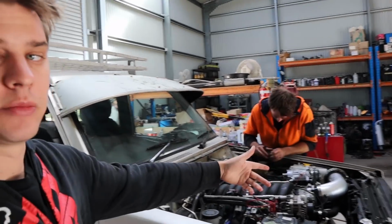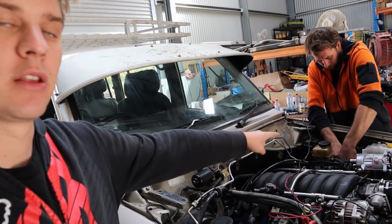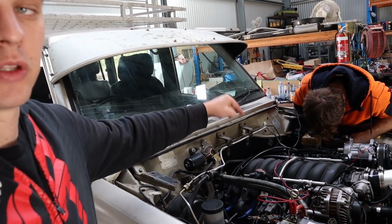All right, so the experiment did not prove what we expected it to prove. We are seriously getting to a point where we're about to start tearing our hair out. We repinned 6 and 8 at the plug, and we expected the problem to stick with the wiring that would have been injector 6, because we thought it would be a wiring issue, but it didn't. The issue moved to what was pinned at 6. So even though number 6 injector trigger was running through all of number 8 injector's wiring, the problem moved to that set of wiring, which means it's not an issue with the wiring.